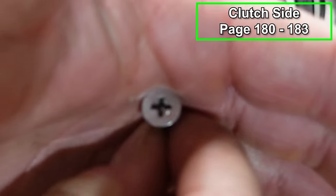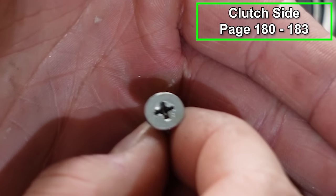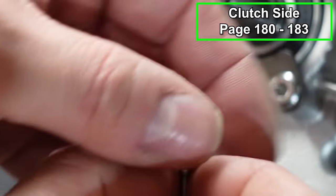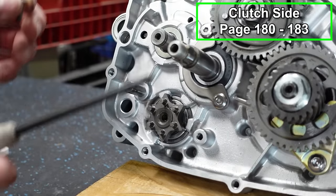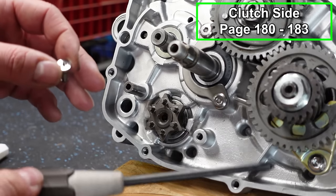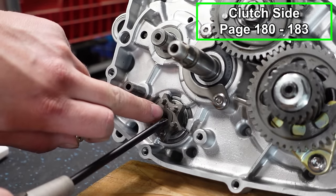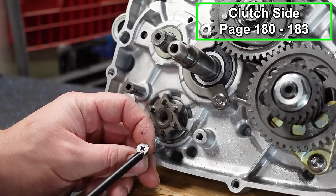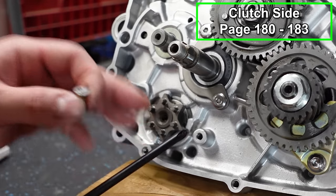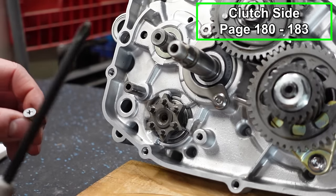Now you'll notice on the top of the screw, there's a little dot there. That dot indicates that this is a JIS screw. JIS stands for Japanese Industrial Standard, and it's really recommended that you use JIS screwdrivers for them. If you notice, whenever you use Phillips heads on Japanese bikes, they get jimmied up really easily, and it's usually because people don't use JIS screwdrivers. So get yourself a good set of JIS screwdrivers before you do any work on any Japanese bikes. I'll have them linked in the description below.